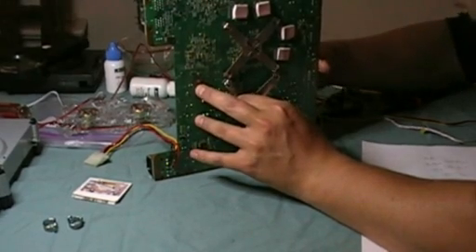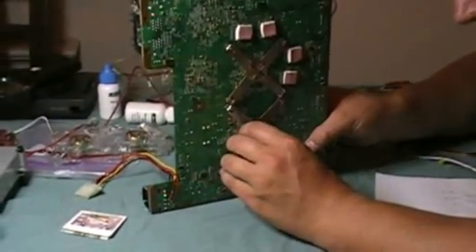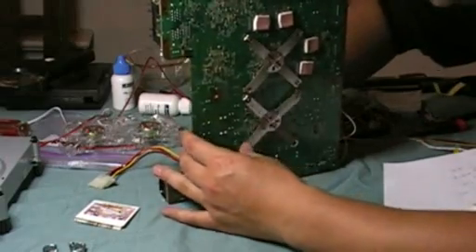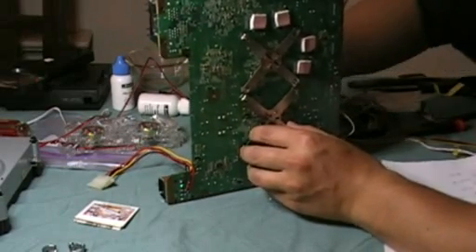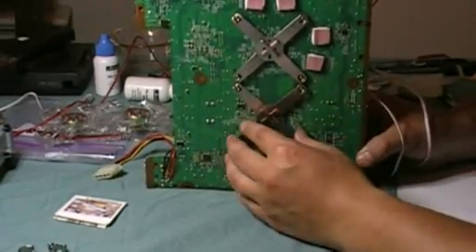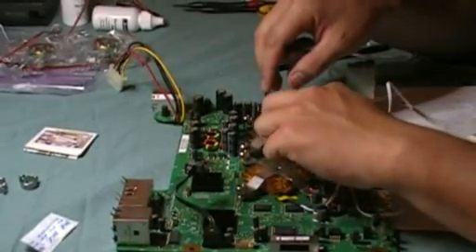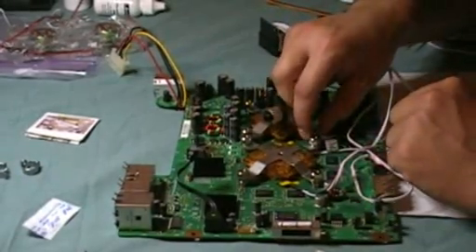There's the top one on that side, the top one on that side, and I'm going to click the bottom one in there. It's always the last one that seems to be the trickiest, so don't worry if it takes a couple of times to get right. Sometimes you just have to move the X around to find the middle. Once you've found that middle, your heatsink will be fairly loose — wiggle it back and forth to make sure you're in the right place, then slowly start going around the cross and tightening all the screws, going in opposite directions.